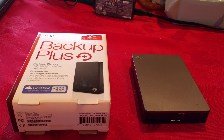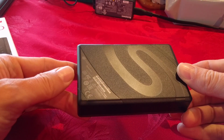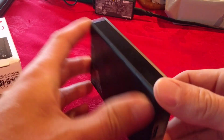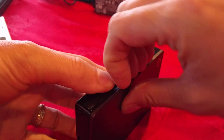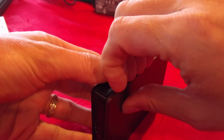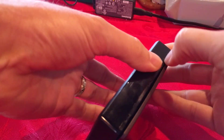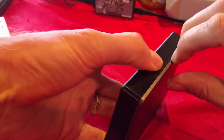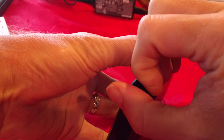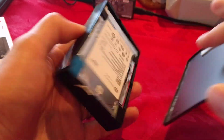I'm going to show you how to take this apart and get the hard drive out of the box. This thing is actually pretty simple — it's the Seagate model. There's a little lid on the top which you could use a screwdriver, but why bother? Your fingers do a good job of pulling it off gently. There's a little bit of glue. It doesn't take that much effort. One side was easy, the other side is a little more difficult, but the top just comes right off.